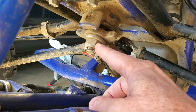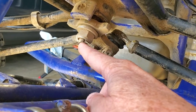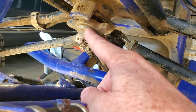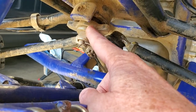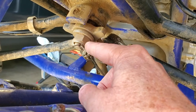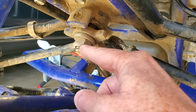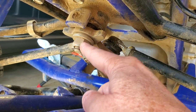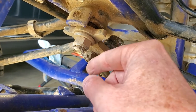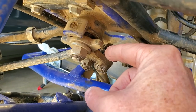It's not a bad idea to go ahead and stick a mark where this hole is — put the mark back up on your little arm here — just to make sure things get in line. You want to make sure everything's in alignment when you put it back in so your handlebars are not crooked. I'm going to go ahead and start getting this one off, then we'll get the steering stem out of the way and show you how to get that bearing out of there.